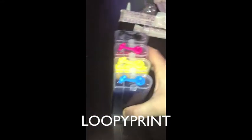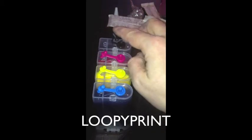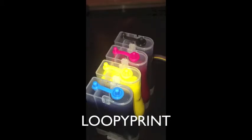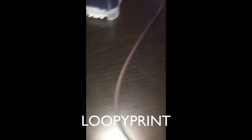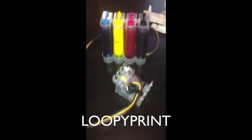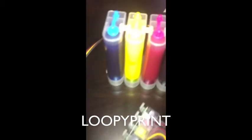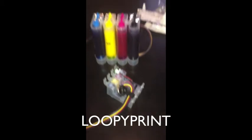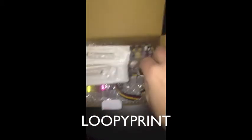If you're going to use it, leave the back breather holes open. If you're not going to use it, make sure everything is sealed on top, then look down the pipe and make sure there is no air in any of the pipes leading from the ink pot to the cartridge. Now everything is completed — an ink cartridge that is full, all four pipes will be full, the ink bottle will be sealed with the sealed unit. Full, packed, ready to go.